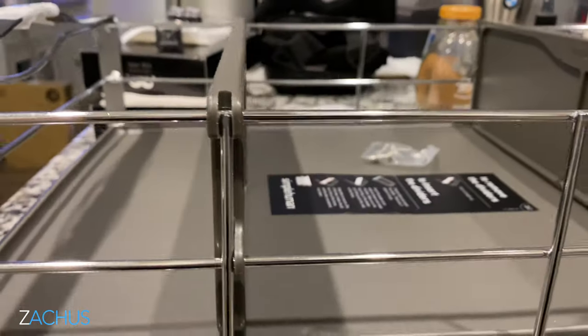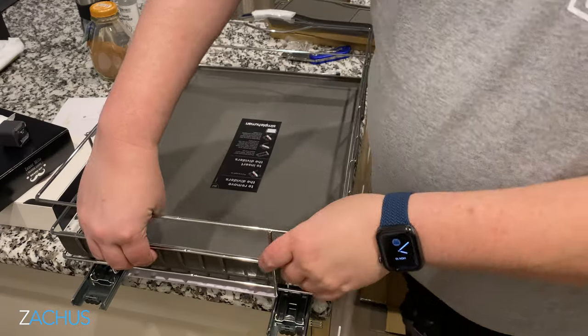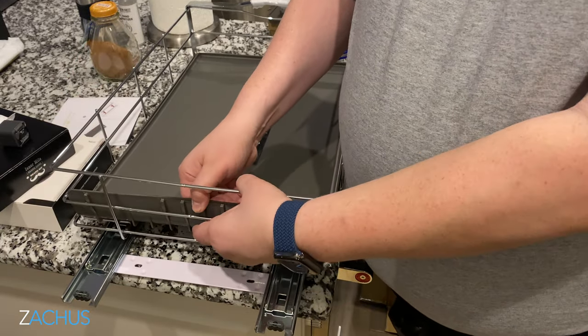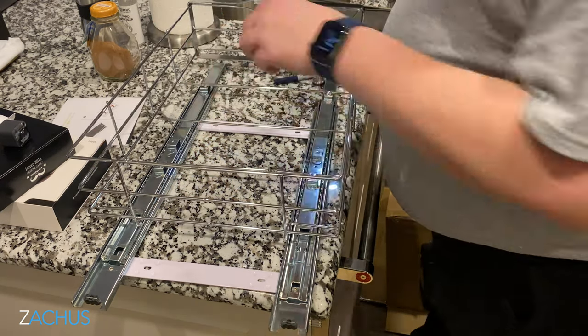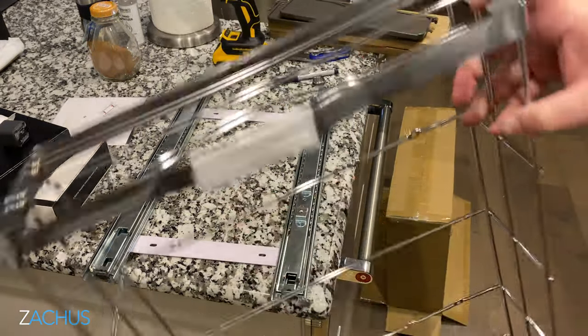The tray — there's a gray hard plastic tray in the drawer, which is awesome because it's going to trap everything from falling down and getting all messy in your cabinet. All you do is push it in on the side that lifts up. It's all the way across, so you hear it snap free, and then it's going to slide out at an angle — just pull that out and set it aside. Then you're going to see four screws in the slider. You want the drawer closed up tight, then just take your drill with a Phillips head and unscrew those four screws. They come out really simple and the wire tray just comes right off.